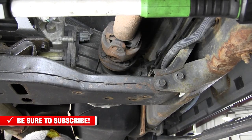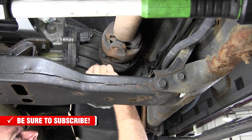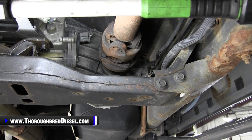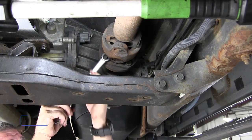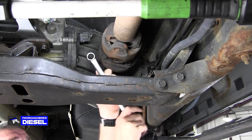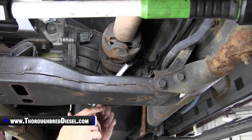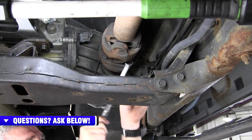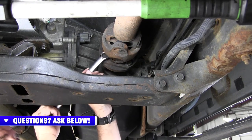We're going to go after the front drive shaft now. Same way — we want to mark the phase so we don't have to worry about a vibration once we get everything back. Then we're going to remove the four 16 metric bolts. I've got a long 16 metric box end that I use on this. Usually I try to have the truck in a position where I can get to two of them, then jack the front wheels up, rotate the shaft, and get the other two. You really can't get a swivel head impact wrench in here, so it's a lot easier if you do it with a ratcheting wrench.